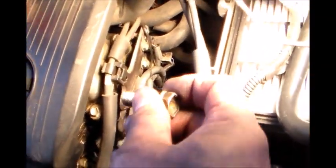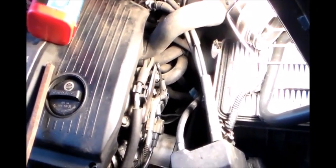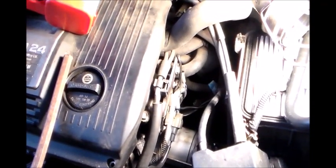I'm just gonna have to kind of reach in there. It's hard to film. But the bracket I showed you needs to go with this bolt. Okay, so fit it in there somehow. If I can't film, I have to stick my hand in there and feel for the bolt as it goes into the hole. Okay, I reached over in there with my socket wrench, 9/16, was able to put that bolt back with a bracket and also connect the wire on that side there. It's hard to film, I couldn't film it, sorry.